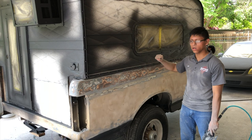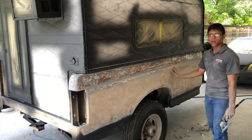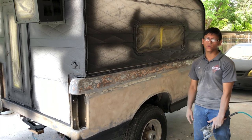The customer used glue to join the camper in the bed. So all we're gonna do now is finish sanding this part, clean it with paint thinner, put on the adhesion promoter, and then we're gonna try to wrap that area again.